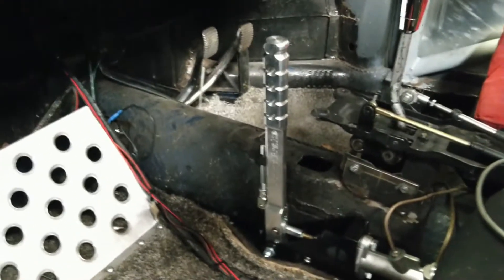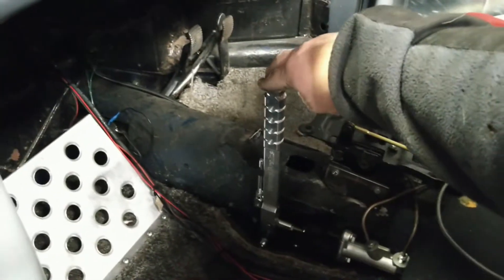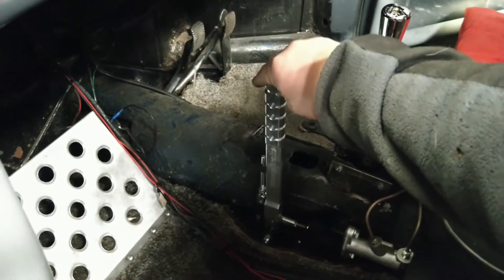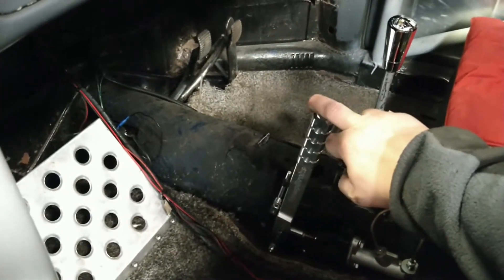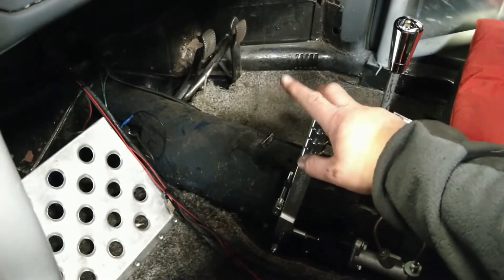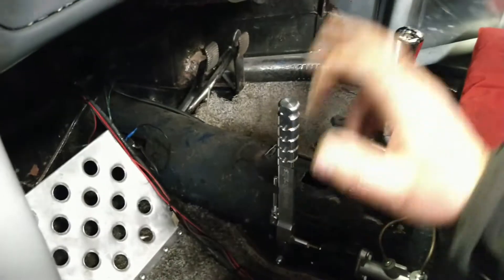The next thing is to install the switch for launch control. What I've got here is a hydraulic handbrake set up on the back wheels as a staging brake. The idea is you get to the start line, hold it against the brakes so you can get the boost built up and get ready to launch, then let go of that and away you go.